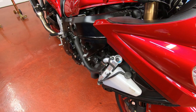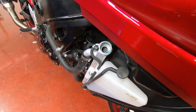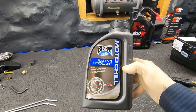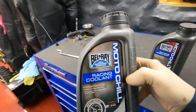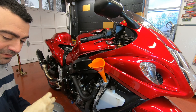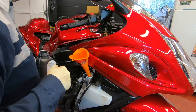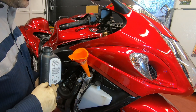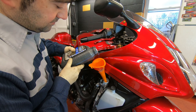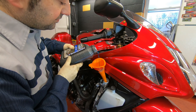And when you do that, obviously the next step is to fill up the cooling system, but there is a trick to it — you don't just fill it up and call it a day. There is a little detail to it. I'm gonna be using this coolant here. There is a variety of coolant, but as long as it's made for motorcycles, you're gonna be good. That trick I was talking about: you want to pour the coolant slowly so air doesn't get trapped inside the cooling system and need to be bled more. Just go nice and slow to minimize the air bubbles entering.